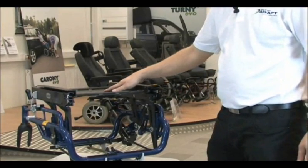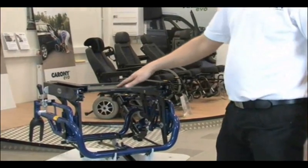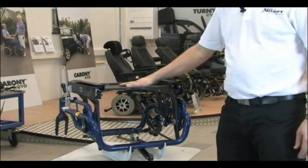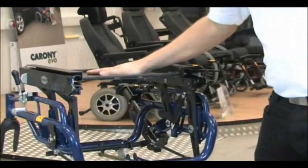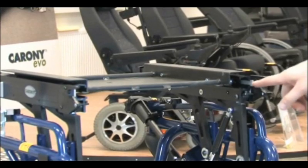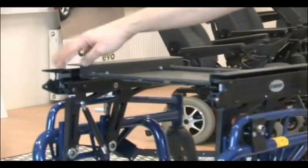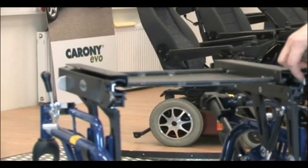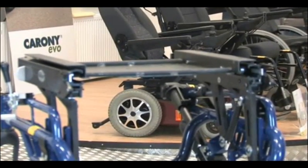It moves with no friction at all on ball bearings. But it's not a good idea to have the seat loose like this. We need to lock it in position. And it doesn't lock even if I push it hard several times. We need to push the 2 metal bars, one on each side, silver color right inside the locks, to release the locking device on the locks.